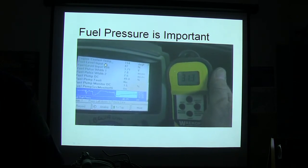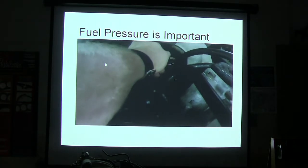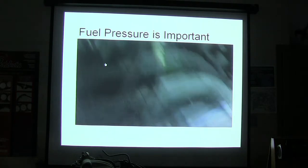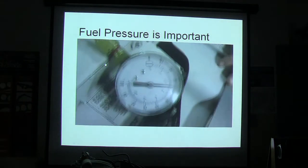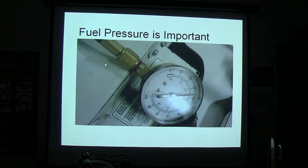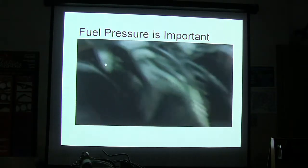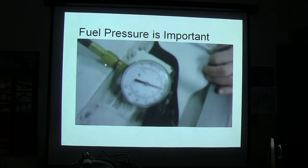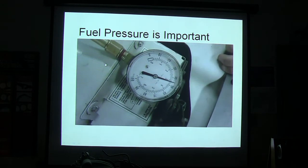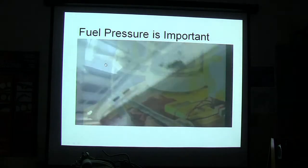All right, we're going to start with a fuel filter. We've probably got a bad fuel pump on this car. Problem here, and what we got, we'll pull the vacuum hose hooked up to the fuel pressure regulator. We got 35 pounds, right? All right, so in order to smoke out this problem, we're going to pull the vacuum line off the fuel pressure regulator. Now we got 45 pounds, and when we snap accelerate, the fuel pressure goes away. We got a weak fuel pump.